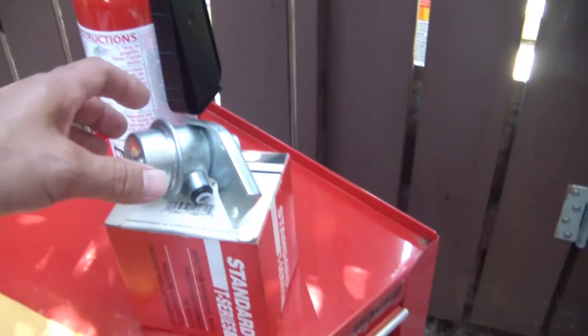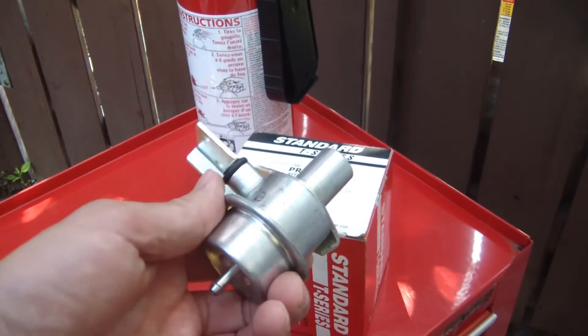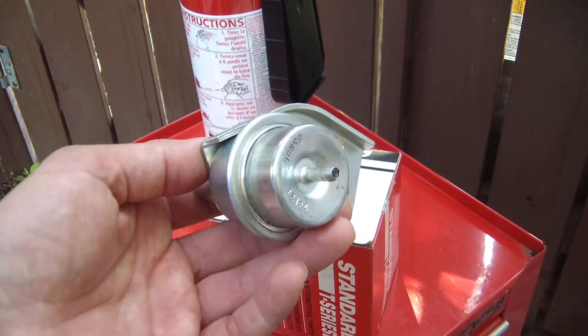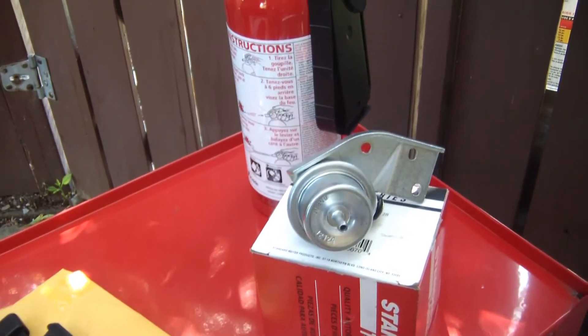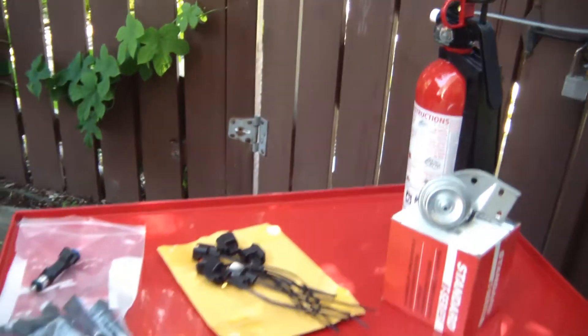While I'm pulling off the fuel rail I will also be replacing the fuel pressure regulator. I am having difficulty with starting — it takes a couple of cranks to get it going. That will help, along with what is probably a leaky fuel injector. And of course I have a fire extinguisher on hand in case things go bad — hopefully not.